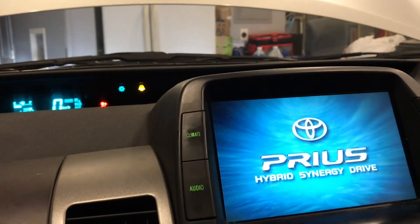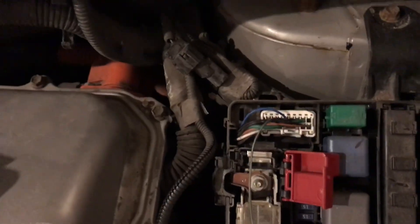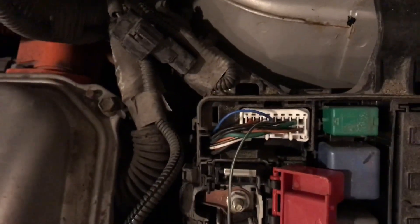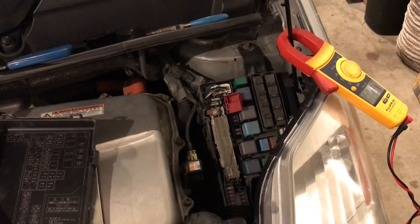As you can see, I'm not getting a park lock problem. I used to only get this when it was wet weather outside. My guess is that this wire has a problem — I tried with my multimeter to find where that broken connection was and I could not find it. So I'm going to route a slightly longer wire; I just did this temporarily to test it and it worked. Good luck, give it a try and see if it works for you. Thanks for watching.